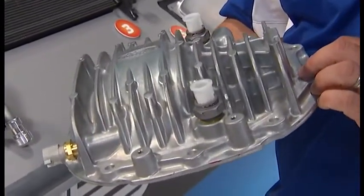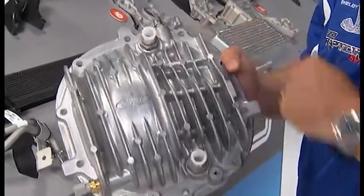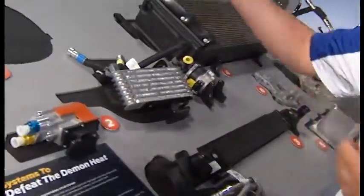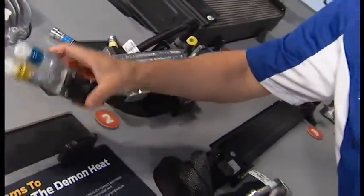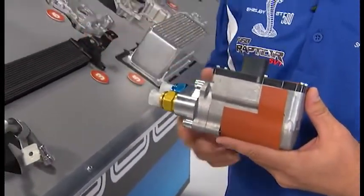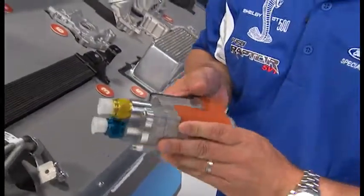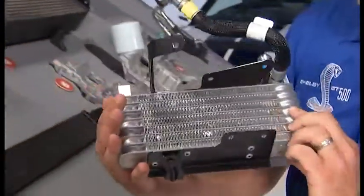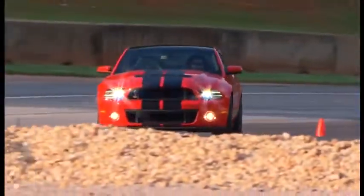If you're going to be on a road course for extended periods you need additional heat rejection capability. So on those optional cars we have a couple of extra fittings added here and also a temperature sensor. This temperature sensor is used to control an electric axle oil pump which you see here. It is mounted over the axle to the body. Oil is pumped from the axle cover through this pump, then goes through a set of lines that run all the way to the front of the car. In the front right corner of the car we duct air to the axle oil cooler, reject the heat to the air, and send that cooled oil rearward in the car to the axle.